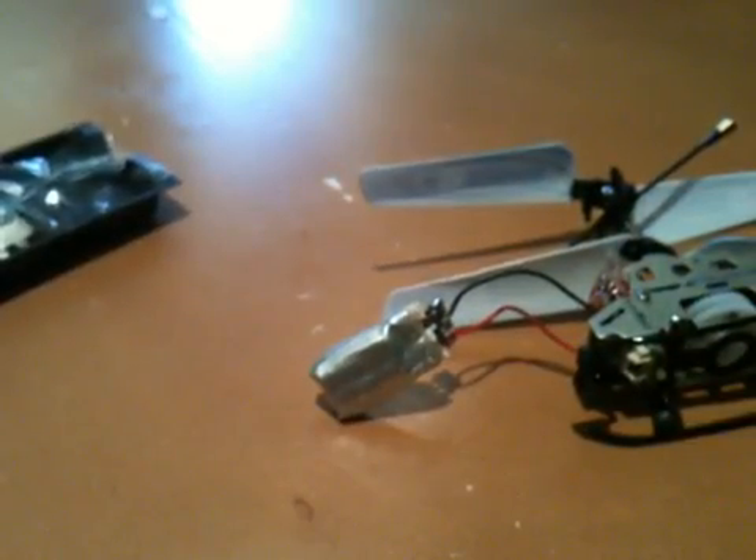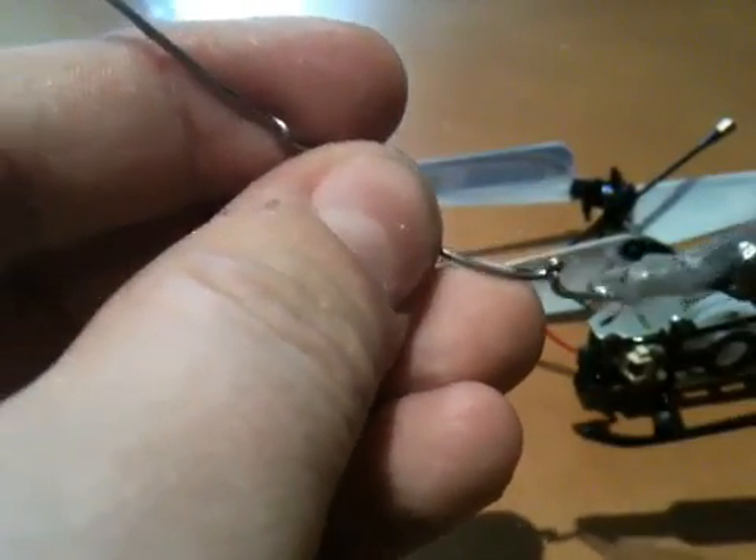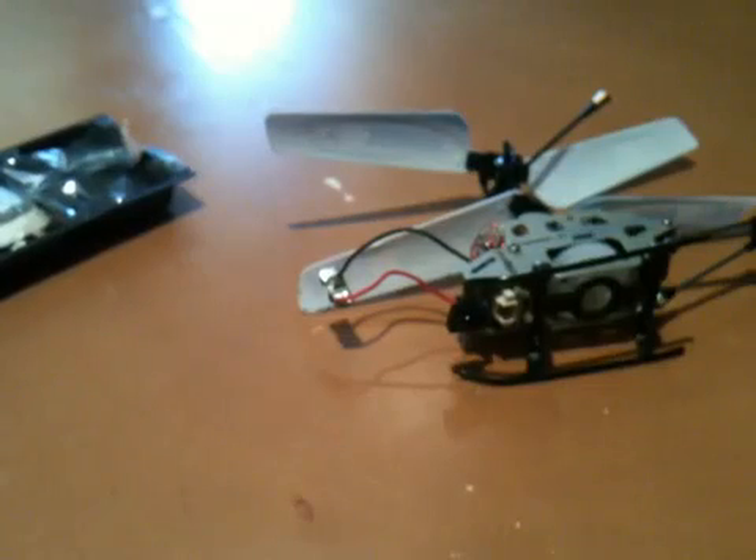Here's a little trick: use the weight of the helicopter to remove the circuit board. Grab the soldering iron, put some extra solder on there, and lift the helicopter by the battery to apply the solder. There's one wire off — and the next one. Nice and easy — the weight of the helicopter pulls the battery off the circuit board.